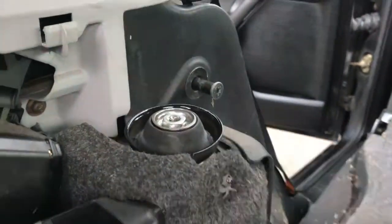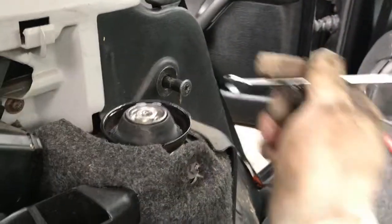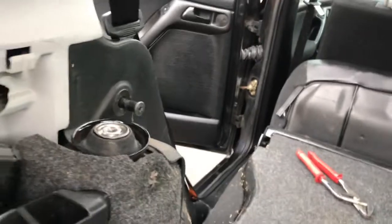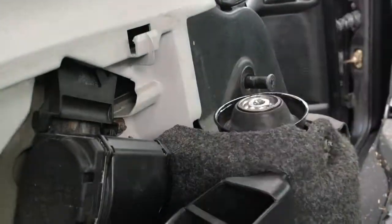A quick tip for you: if you're struggling to get this nut off, you can get a really small spanner — I think it's a six on the top there. What I've done is I've used a set of spring compressors on the bottom to compress that spring, and it's detached from the rear beam. With it hanging in the air and compressed, it's a lot easier to get that nut out of there.